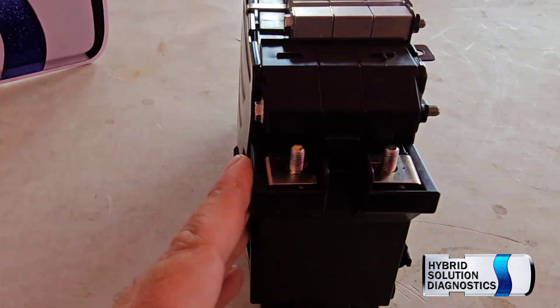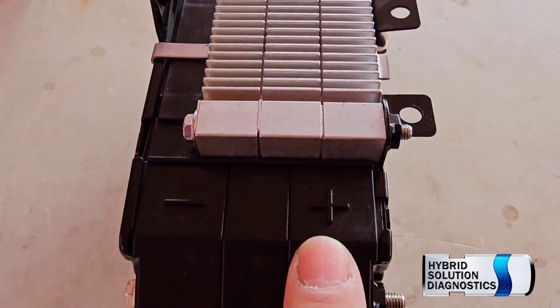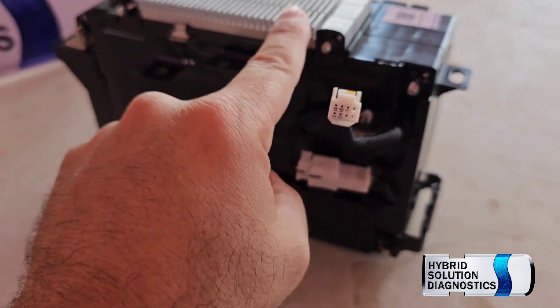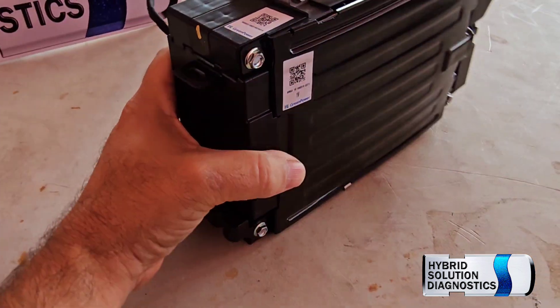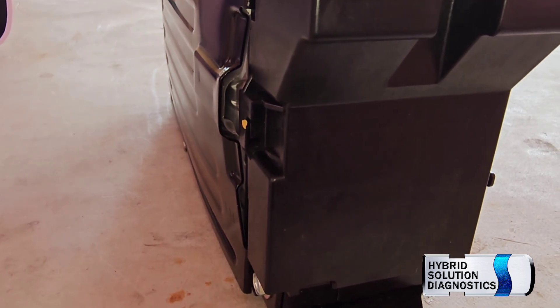The first thing we're going to do is take a quick look at the battery itself as a complete unit. You guys remember that we replaced this a couple of episodes ago, and I was saving it for school purposes. I'm actually taking it to school for my students, but I also wanted to share with you about the integrity of this battery and all of its components. So let's take a quick look first before we take it apart. Positive and negative lead, which of course always has a voltage. The thing we need to remember is that this is a lithium-ion battery — I think it's a lithium polymer. As you guys can clearly see, this battery is super swollen.